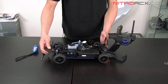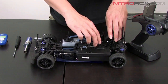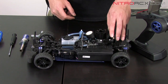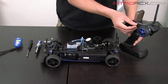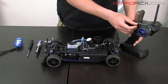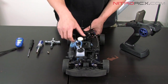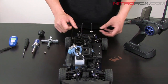Now, if you take a closer look at the throttle linkage assembly, you'll notice this is the servo horn. Then you have a spring linked to your carburetor. You want to make sure the throttle servo is perpendicular, not engaging the brakes and not opening the carb. So have it set like this. Take your air filter off, peek inside the carburetor and check the opening.